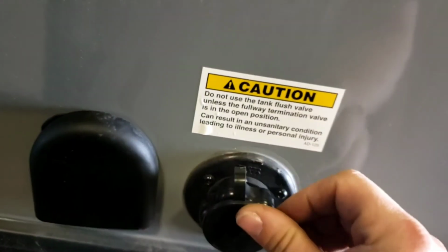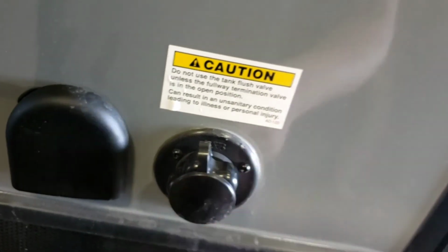And then right here, black tank flush. Another one, you can hook a hose up to here, turn it on. As you're dumping your black tank, flush out your black tank. That's going to keep it from smelling. Right over here, almost done on the outside. Vents for your fridge. You got bottom and top. Just make sure they're clean up in here, not blocked by any debris. And then every once in a while I recommend taking these panels off. Just give these a quarter of a turn and clean back there.